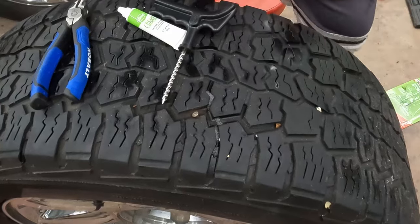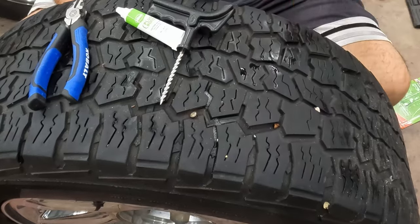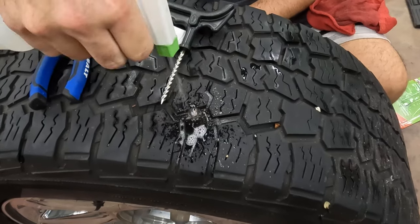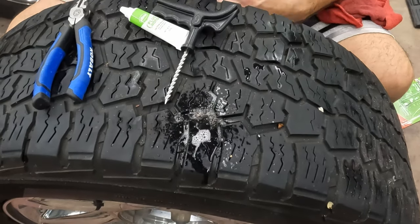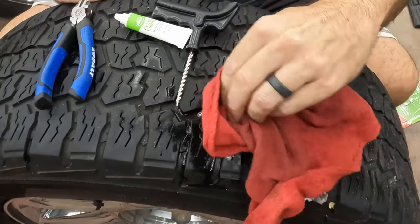Angle you back down so you can see the tire good. There's the nail. In this case the nail is pretty obvious, but it isn't always. Sometimes after a while you'll grind that head off driving on it and it'll just be the nail itself and it'll be hard to see. So if you can't find it, you can squirt some soapy water on it and see how it bubbles — that's the air coming out making bubbles in the soap, and it'll tell you where your leak is.